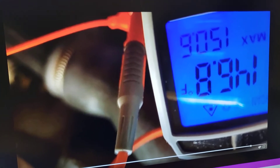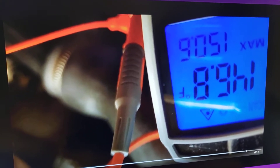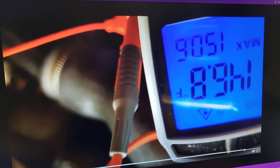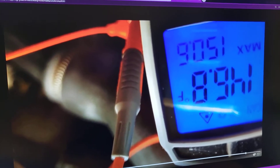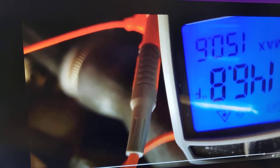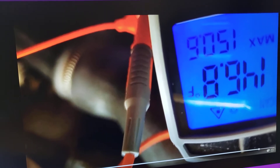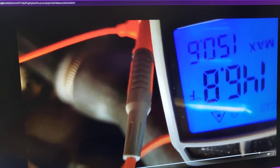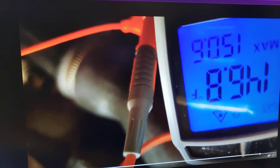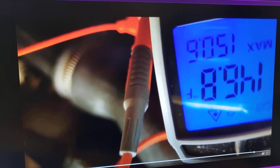I used another product called OBD11, which is an application you can download to an Android phone or iPhone. You can buy the OBD11 product — the Android version for about $65 on Amazon, plus you have to pay about $30 more to get a pro license, so for Android you could get OBD11 plus the pro license for close to $100. They have an iPhone version for about $150. Using that product, I could test the temperatures another way by connecting to the car with OBD11, going to engine, clicking on live data.